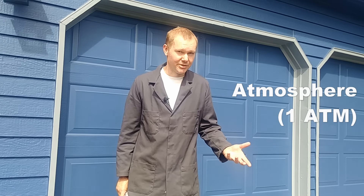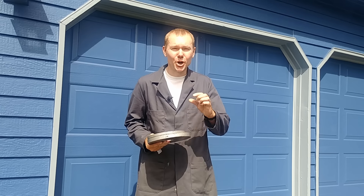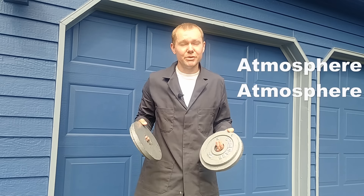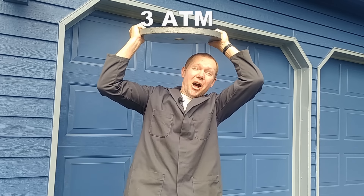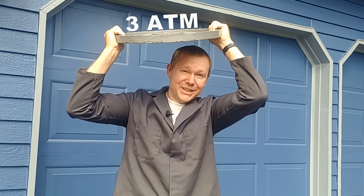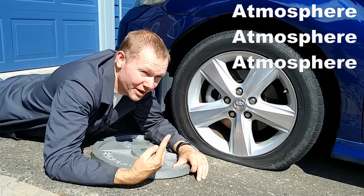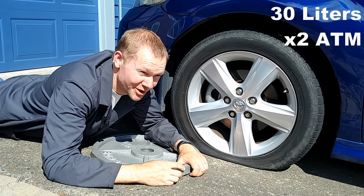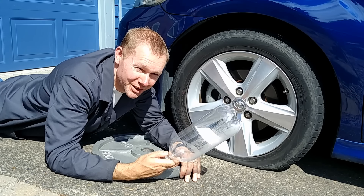So how much compression does the air in the tire need? To understand that, it helps to think in terms of atmospheres. Earth's atmosphere is so thick it actually has weight to it — about 15 pounds per square inch at sea level. If we double that, that's two atmospheres, and triple it is three atmospheres. That's actually a little bit less than what my tire needs. Now even a completely flat tire still has one atmosphere in it, so technically I only need two atmospheres to fill it up. So 30 liters times two atmospheres would be 60 liters of normal atmosphere, meaning I need at least 30 of these two-liter bottles to fill this thing up.